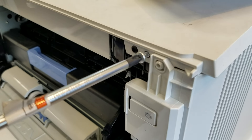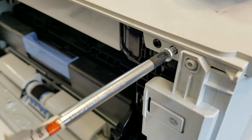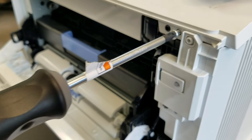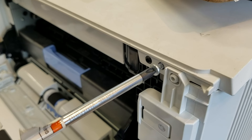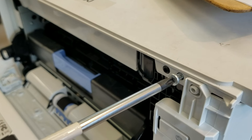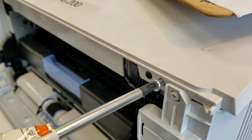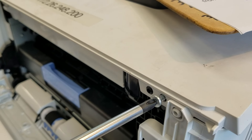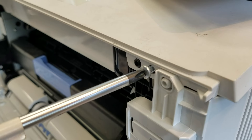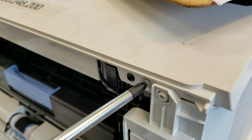It's recommended you pick the right screw bit or screwdriver and make sure it is dimensionally aligned with the screw you're using. Hold it in the right position — straight on — and avoid any type of angles. Insert it by hand, rotating the screw counterclockwise first until you hear or feel a slight bump or click, and at that point rotate it clockwise. This will minimize the chances of stripping the frame or the screw threads.